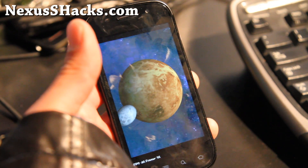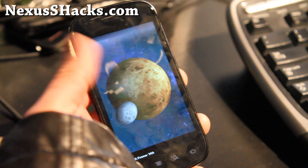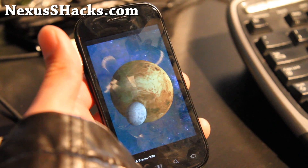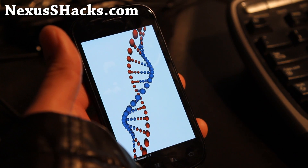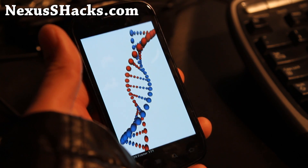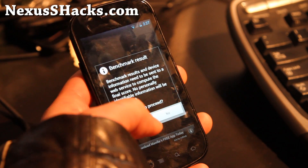Part of that is the chip itself. With these silicon chips there are variables, so depending on your luck you might be able to overclock it to 1.5 GHz or maybe just 1.2 GHz. On my Nexus S, even on Gingerbread it doesn't really do well — anytime I overclock it to even 1.2 GHz or 1.1 GHz. So that might be why. I'll have a link to Matrix kernel if you guys want to try it.